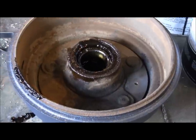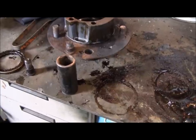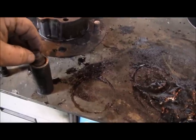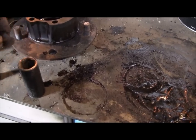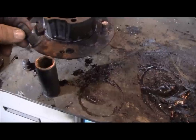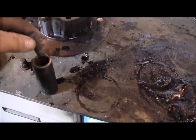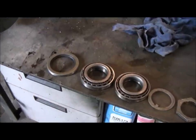We're going to heat up that third screw, pull it out, separate the drum from the hub, pop out the rear seal and bearing, and clean everything up. Now we're addressing the broken wheel stud in the hub. We put a socket underneath the hub to support the area where the stud was and drove the stud through the flange and down into the socket so it wouldn't bend the hub flange. We'll do the exact opposite to put the new stud in — drive it in from the back and we'll have the replacement stud in in no time.